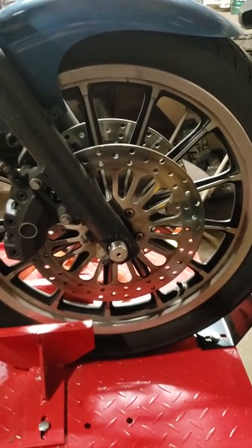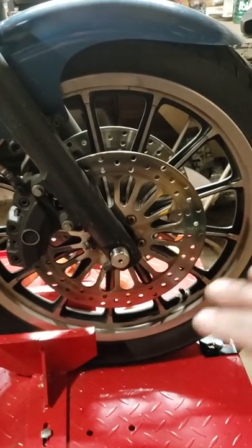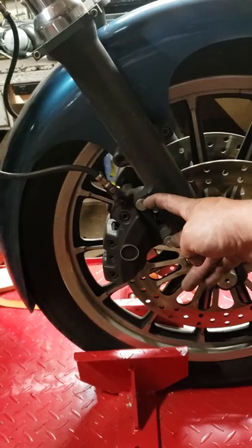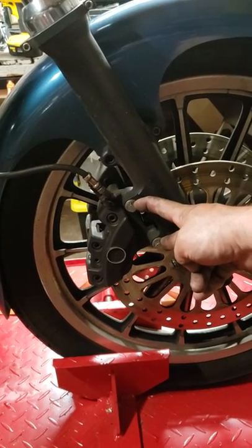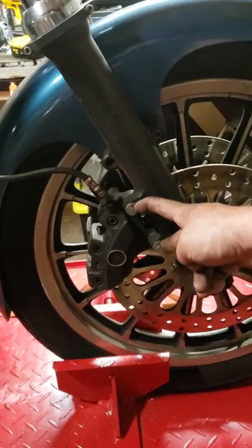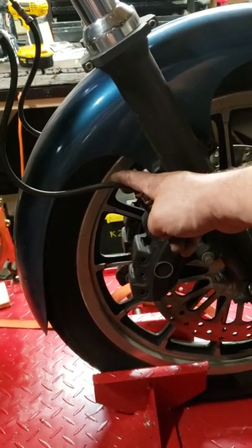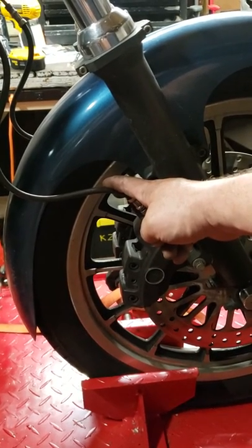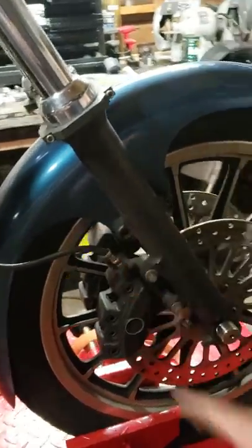They ran an 11.8 inch rotor on the one side, so I just ordered two of those from Ultima. They bolt on here and the heads of the bolts clear. Bought new bolts — the bolts for the FLH bagger brakes, because they are a little bit longer than the stock Dyna caliper ones. Also got an 08 and up Road King brake line, which saved me the effort of having to get an aftermarket custom-made steel braided one.